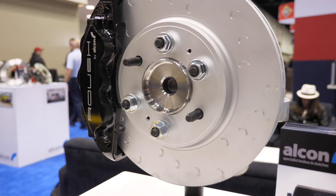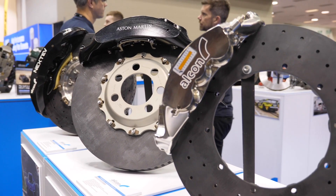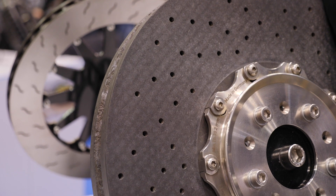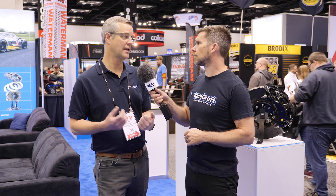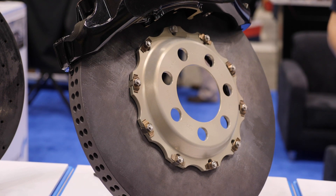The first upgrade of course is a larger rotor. If you increase the size of the rotor then you're automatically getting more brake torque, which is most important. A bigger rotor will generally cool better — a good racing rotor will be designed to pump air through it so it gets rid of the heat quickly. And in terms of the thickness of the rotor, again that can give you additional thermal mass to keep everything under control and also help with the rejection of the heat.